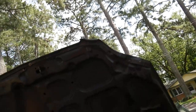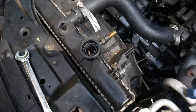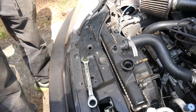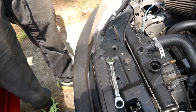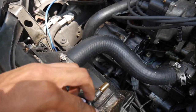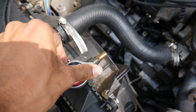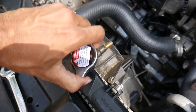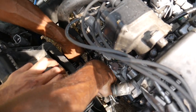The car runs but it overheats very quickly, and that's because the neck over here on the cap of the radiator is cut so that if you put on the radiator cap it spins and pops off — that should never happen. I should never be able to do that. So we're gonna switch that out and get it done.